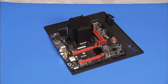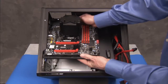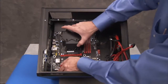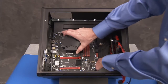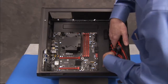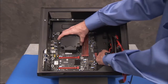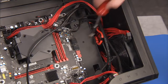To replace the motherboard bracket, align the bracket carefully back into the unit, clearing connectors out from under the bracket. Align the slots of the bracket over their tabs, then slide the bracket towards the rear of the unit. Secure the bracket to the PC with its two Phillips number 2 screws.